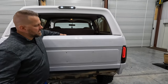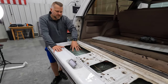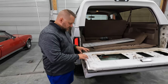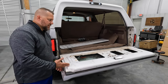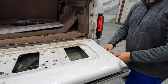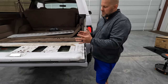Now we're going to drop the tailgate. The carpet and panel that blocks access to the tailgate internals is already off because of the paint job situation. Here's the thing: if you go back up and hit the switch, the glass won't move because there's a sensor. What we have to do is trick the tailgate and make it think it's up and closed. I'm going to push down on both sides to where it thinks it's closed — you've got to click it all the way — and now I can go back up front and roll the window.